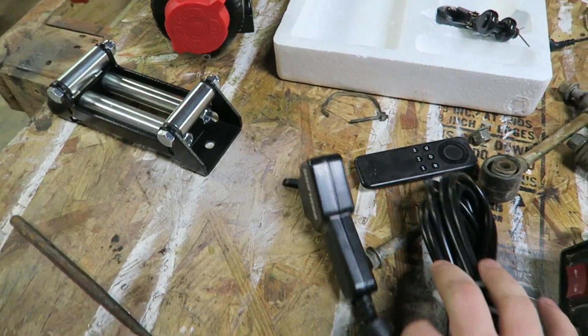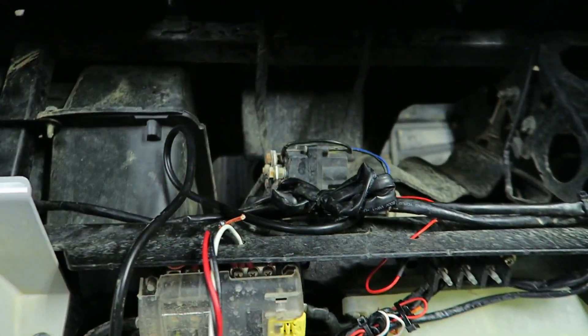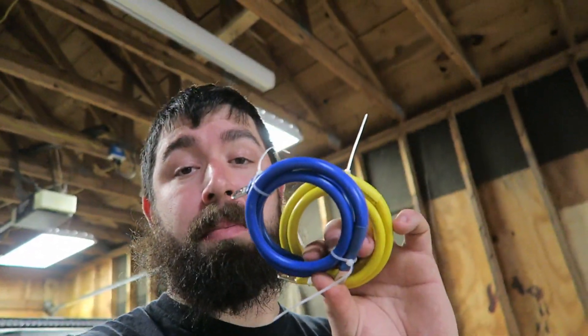I'll show you the switches side by side. The new one is much better looking — it's got rubber over the switch, this old one does not, though it still works. I don't even know if you can use them interchangeably, but I'd assume you could. The other one also didn't come with some accessories like the clevis or shackle, but everything else seems to be the same — the roller is the same, just a different color, black instead of gray. The relay is the same so I'm not going to change it. As I've said in other videos, what has had major issues are the factory power wires going to the motor and the factory wires going to the solenoid — they've been proven unable to take the elements and high loads, so I've replaced those with better wire.